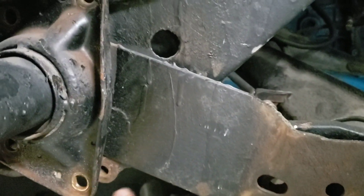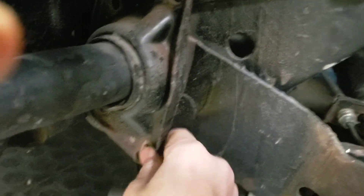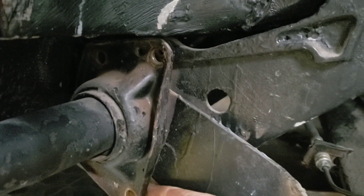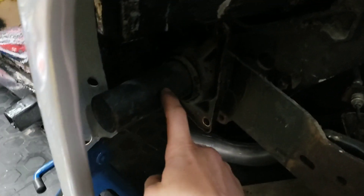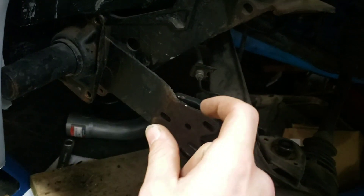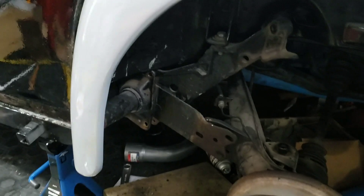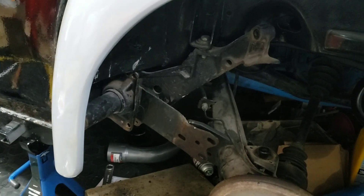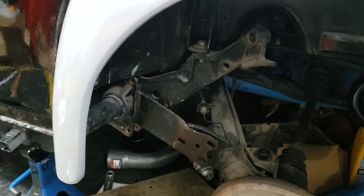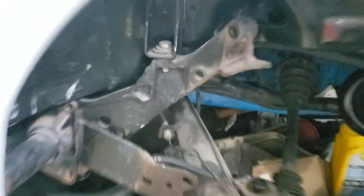As you guys can see in the last clip when I was hammering this off, there's a little ledge just back here and I had to get the spring plate off of the ledge. Now this little cover here, which is honestly pretty stiff, I'm going to wiggle it off and get to the torsion bar inside this torsion tube. All I've literally got to do is pull the torsion bar out, click it back two clicks, put it back in, and that should be a two-inch drop. Kind of thinking about maybe two and a half or even three, but I think we'll start with two. After prying for literally at least 20 minutes, got the spring plate loose. You can see this bushing — it doesn't look too bad. But this orange bar you see in there — that's my torsion bar. If I pull that out and turn it two notches backwards, I'll lose about 5.5 centimeters of height.